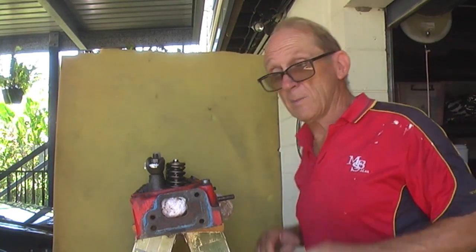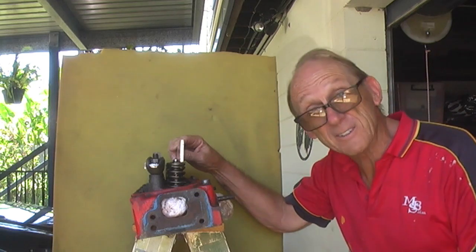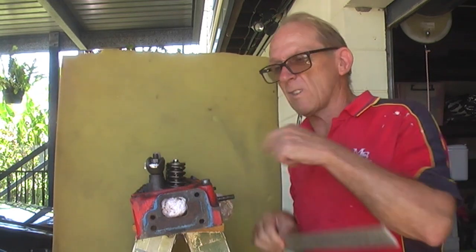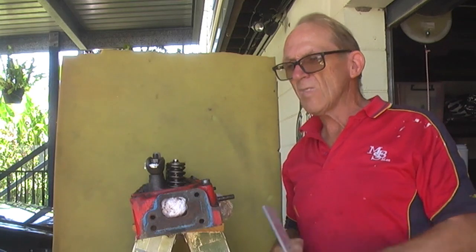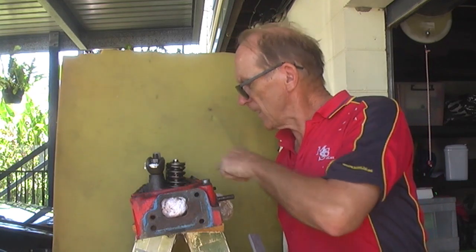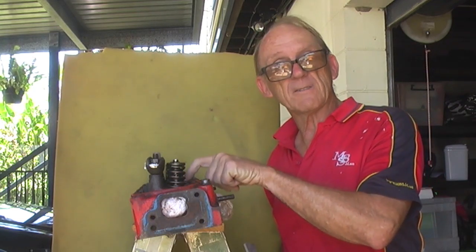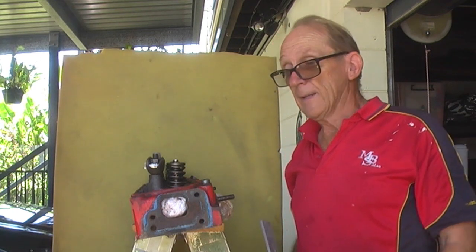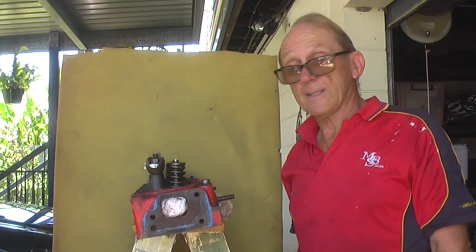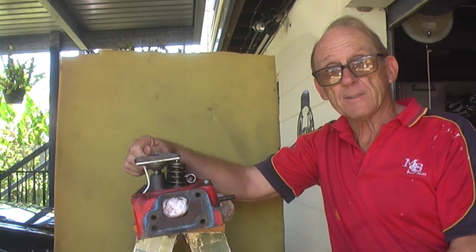While you're there, you might as well do the most critical part — check your retainer heights, make sure they're even. This one is not. It's not as bad as the valve stem tips, and that's because they've probably ground the valve stem tips differently. This is going to have different valve spring pressures. I don't see washers fitted underneath the valve springs to compensate for that. Generally when you've got a valve keeper that has gone a little high, you throw a shim underneath the valve spring to retain the valve spring pressure — and that's not done on this one either. So make sure you check that too. Hope that covered it. We'll see you in another video.